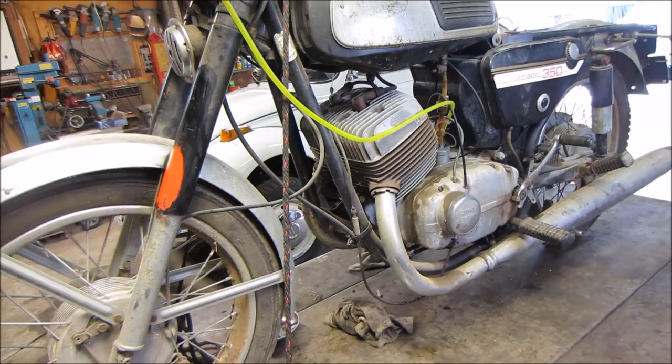This is the little slider. I took off the switch itself. Look at how green those contacts are — that's probably why we don't have a headlight. This fits in a little plastic sleeve, and then the plastic sleeve slides over those contacts, tying the two bottom ones together or the two top ones together. One is probably high beam and low beam. They are not conducting anything right now.